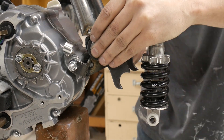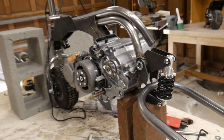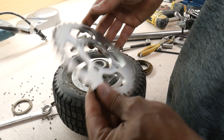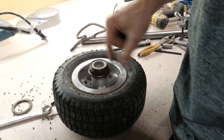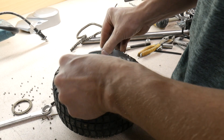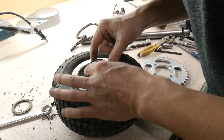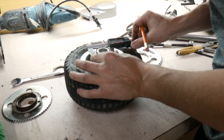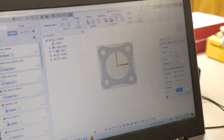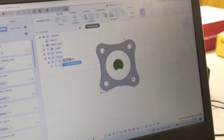But to finish the swing arm, I actually have to mount a sprocket first. So I ordered this nice thick 428 sprocket, and I think I'm going to try to make an adapter that I can weld onto this and then bolt the sprocket onto that adapter. To make the adapter, I just measured the sprocket and then threw that onto the CNC machine.